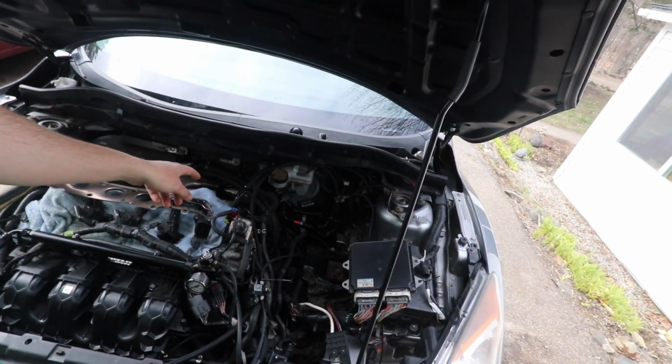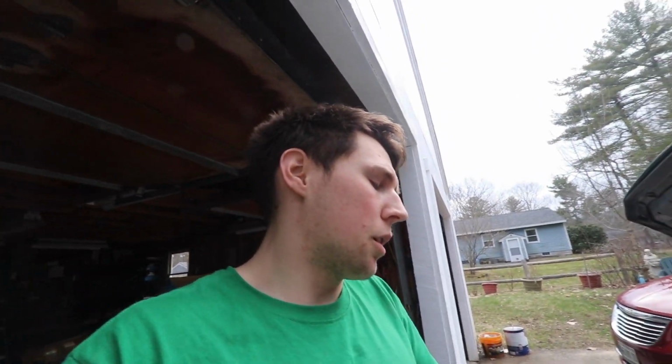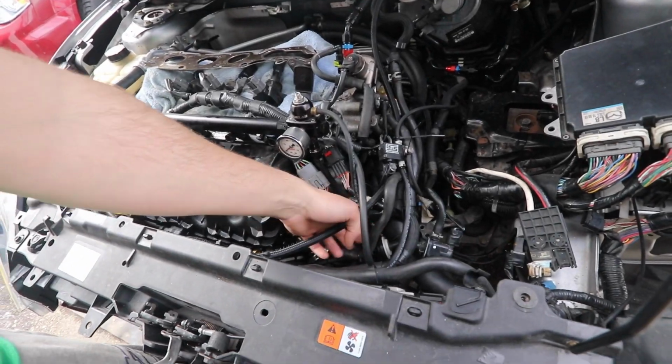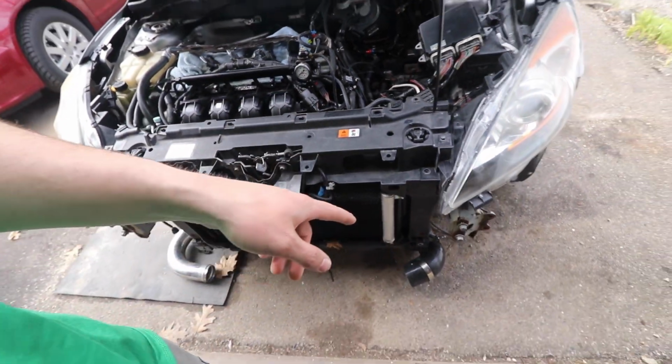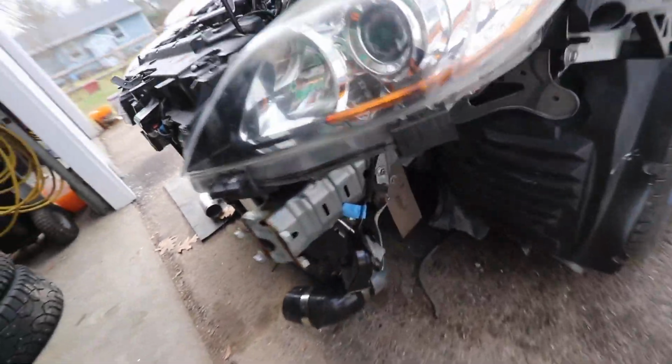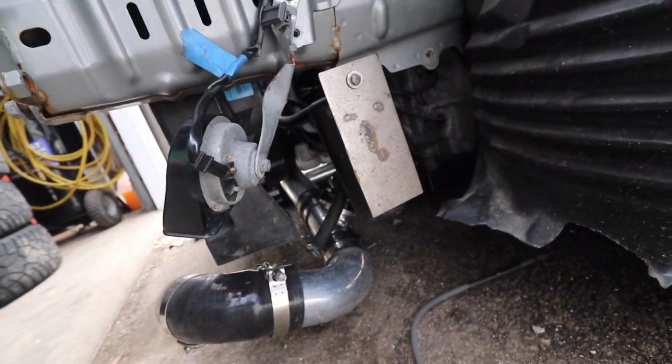I'll do a video on how to make your own boost leak tester, maybe in the next video. At the turbo, one of the couplers was loose, so we tightened that up. There were a few small leaks at the brake booster here, so we tightened that up. The only thing left that was leaking was my blow-off valve, my Go Fast Bits, but it always did that, so I'm not too worried about that because it was a very minor leak.